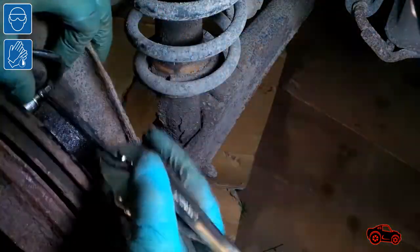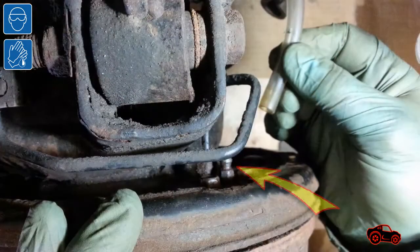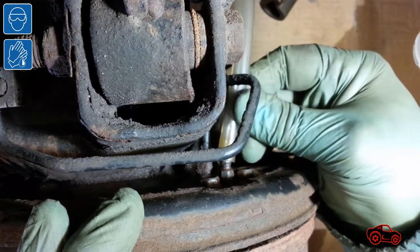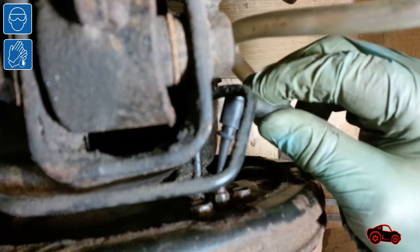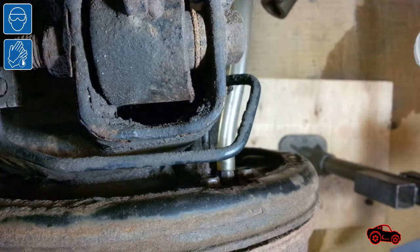Moving the handle back and forth helped reduce the friction between the threads. After, I sanded the head of the bleeder screw to get a better seal with the vacuum hose. Overall, I was satisfied because I didn't have to replace any bleeder screw when bleeding the four-wheel brake circuits. I tried some vacuum adapters but none of them worked properly — only the clear hose was fitting properly.